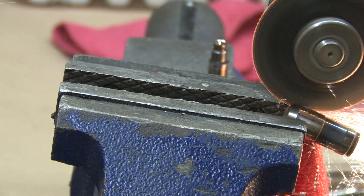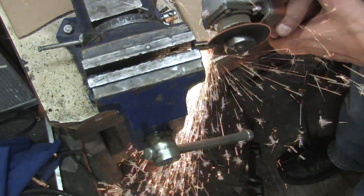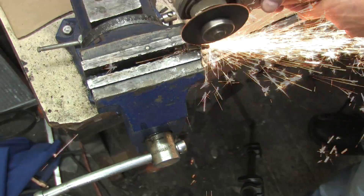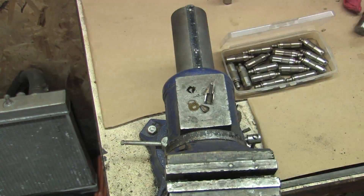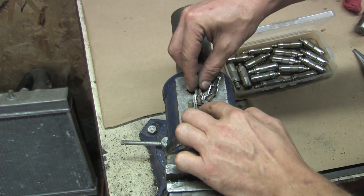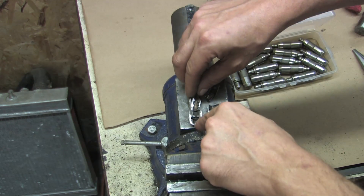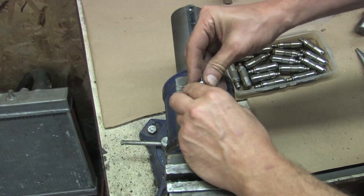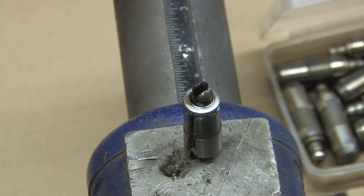But if you're a cheapskate, at least find yourself a set of 2G lifters because you can at least clean them. Recognize that 1G and 2G valve trains share the same dimensions and that they were revised again for another reason. Here's the cone pressed into the upper piston — one piston rides against the other to allow the whole mechanism to work, and the lower piston is cut out around the check valve.